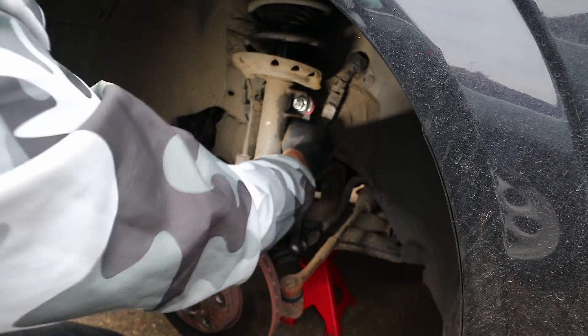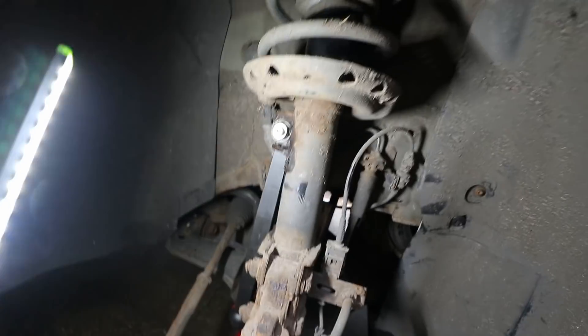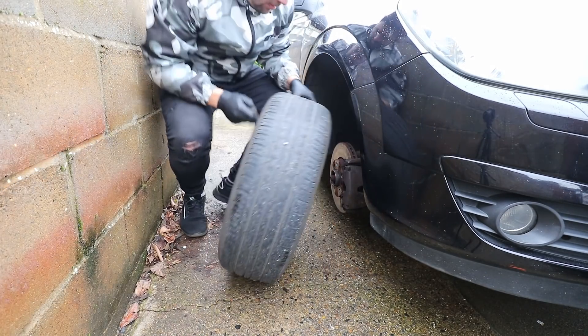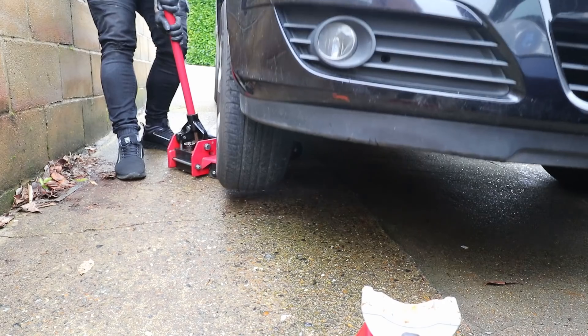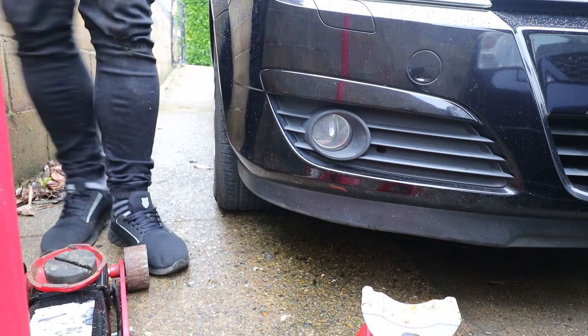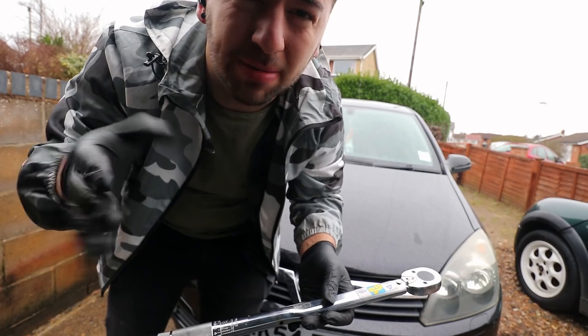Checking that it's sturdy — feels good. No movement in the ball joints, no movement in the bolts. I've already done the driver's side one because access to this one's a little bit harder with the wall being here, so I thought I'd do this one first. All nice and tight, sturdy, no movement. I torque the wheels down to 120 newton metres — that's sort of my go-to measurement for most cars.